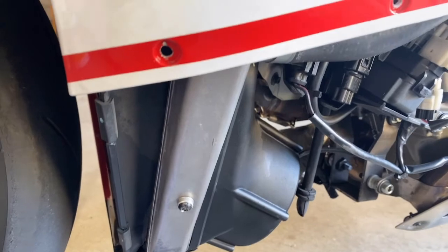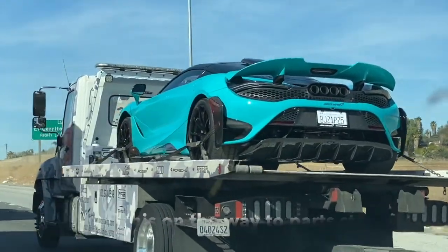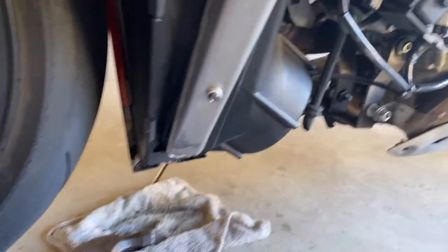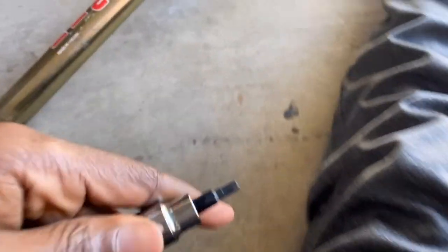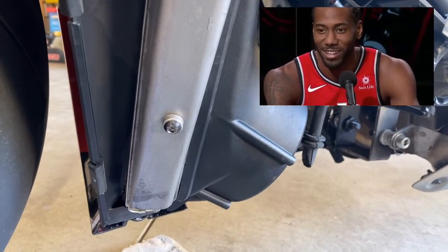Guys, this is freaking giving me heck. I stripped this thing out, and I've tried everything that I could think of, except there's two other things I'm gonna try. Check that out. That is clean. I just sharpened this thing up. I'm gonna try to use it as a chisel, to see if I can screw that off that way. I'm going to try an easy out, and if that won't work, I have epoxy, where I'm going to glue it into this hole, let it cure, and then see if it'll back it out. That's where we're at right now.